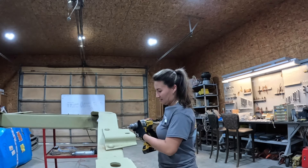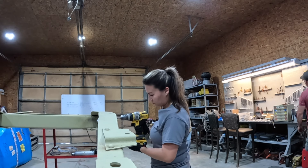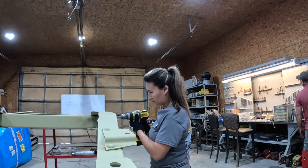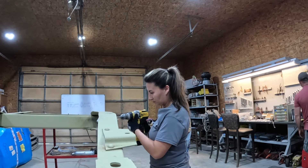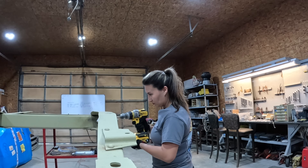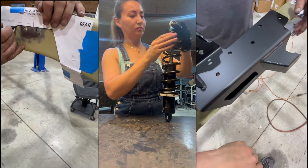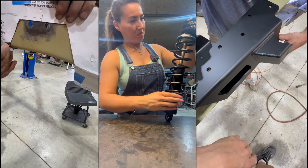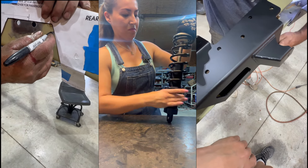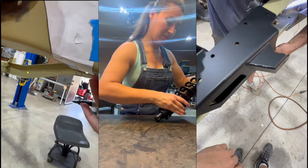Okay everyone, so here is where I'm up to with my Chevy C10 build. This is a long bed, and I'm using the bolt-on quadrilink rear suspension kit from Detroit Speed. I have no mechanical or automotive background, which is why I chose to go with the bolt-on kit. This has everything I would need, including the frame notch, which is what's happening in this video. The kit comes with the chassis brackets, the adjustable swivel link system unique to Detroit Speed, the coilover shocks and springs to give me the lowered ride height I want without bagging it, as well as all installation hardware.